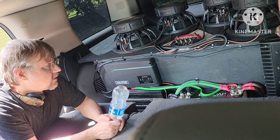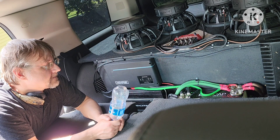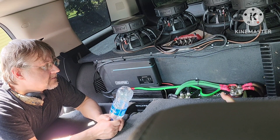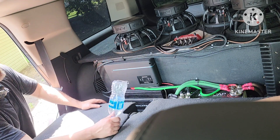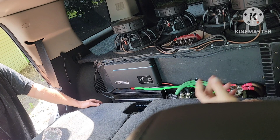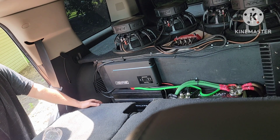Through the app, you can see the current voltage and state of charge. Here's another feature: say you've got this on your vehicle and you left something on and ran your battery dead — click, click, nothing. Open the app, push the start button, and it'll tell the supercapacitor to turn on without the battery. It bypasses the safeties and comes on. Even if your battery has just five or six volts left, it'll draw that voltage, slowly charge itself up over a few minutes, then you hit the key and it'll start your vehicle.